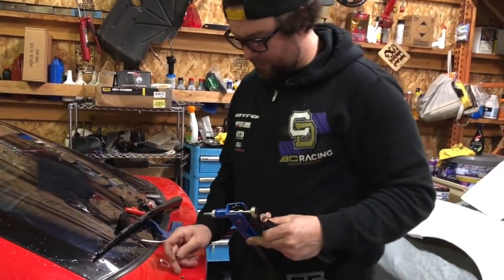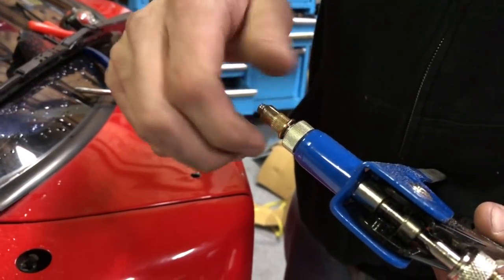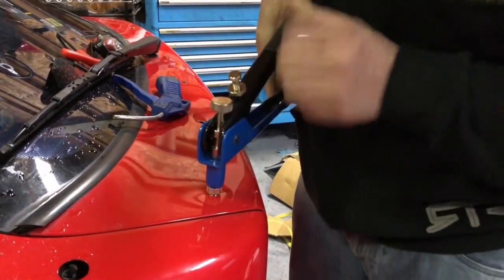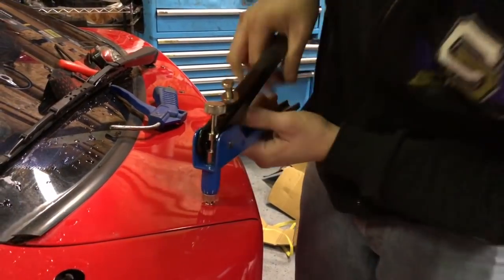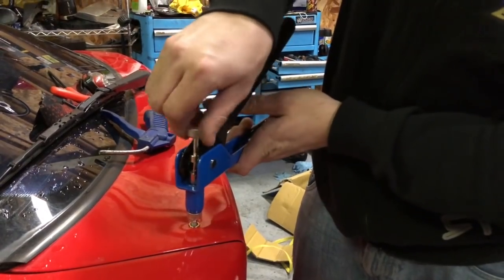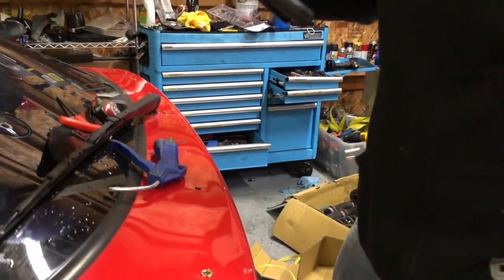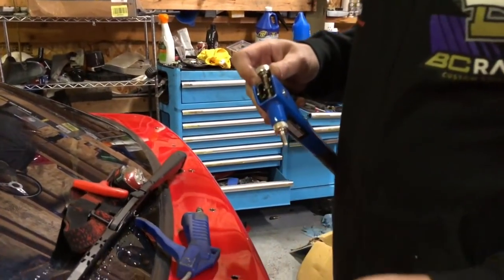Yeah, so how these work is basically you'll thread this on just like a normal rivet, how you stick it in the hole inside of it. You'll push these in here, which is how I have really tight fit. And then just like a rivet, you'll pull that on there and then you just use this to unthread it out there. A little tip for it is I put a little anti-seize on here every like 15 or 20 riv nuts. So that's in there, that's flush.